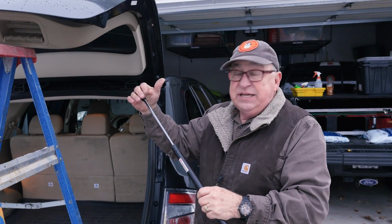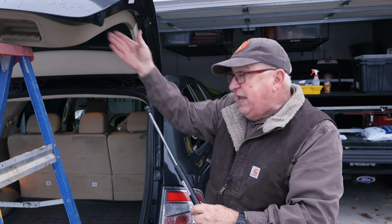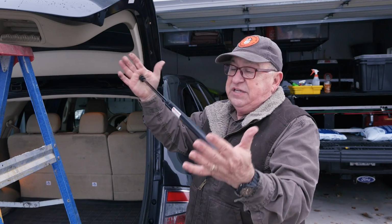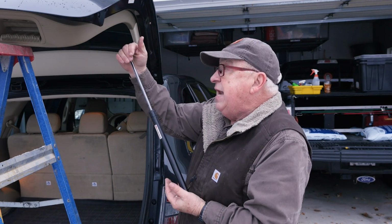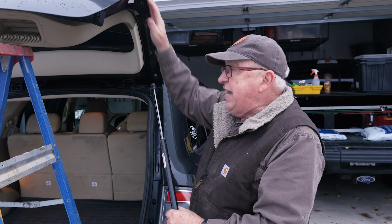No, it better not. It's doing an incredible amount of lifting work, as you can see by the weight of this lift gate. And if you could actually compress this, you have a defective unit here. It's got to be very strong, and you cannot press those together. You need the leverage and the weight of the gate to actually compress it.